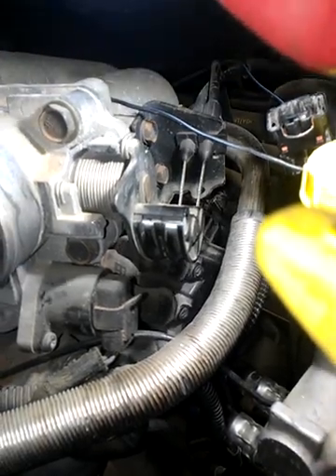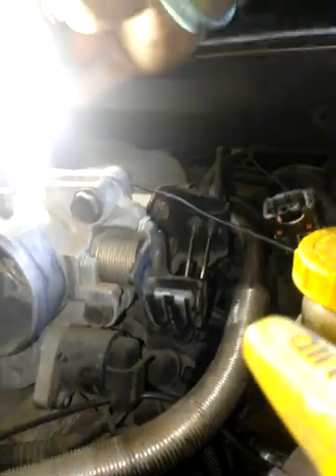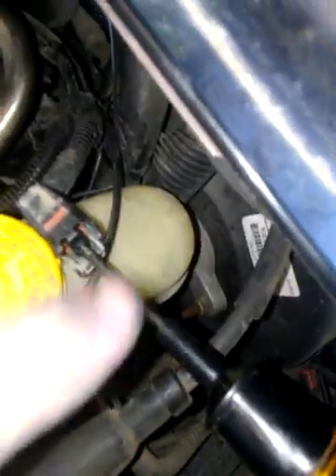See the numbers on the cap? Inside there you have a coil and a pickup unit. Essentially what we're verifying now is that we have current to this plug — this is your 12-volt supply. We're going to hook up this test light and make sure that the probe doesn't touch anything on the body that's metal, otherwise it will short the ECM.